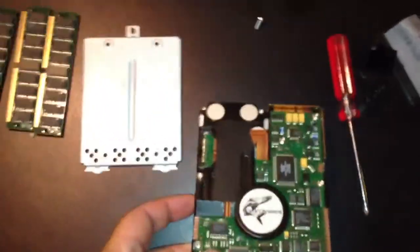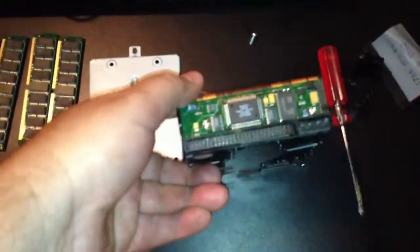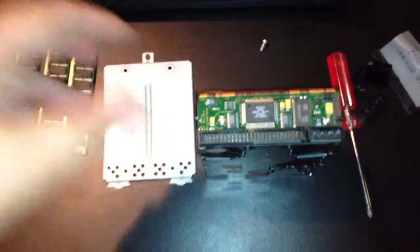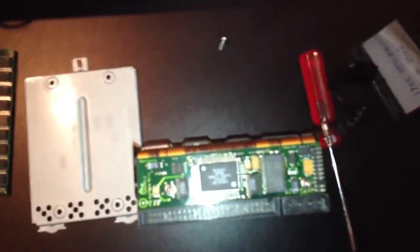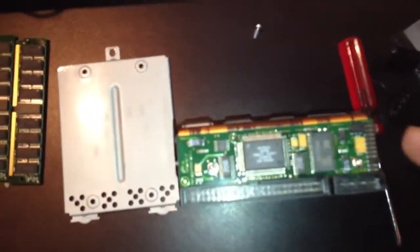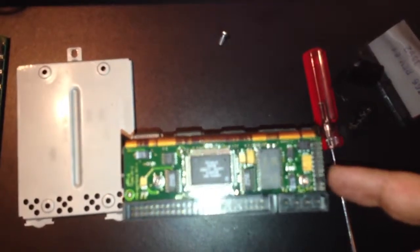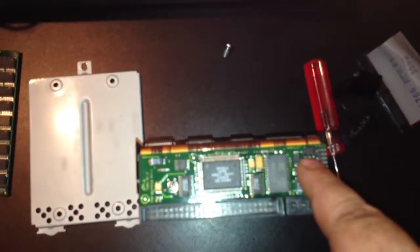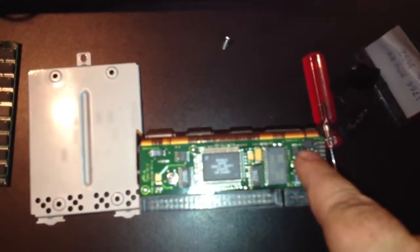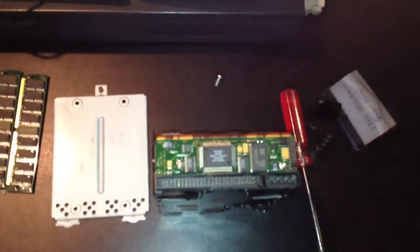And this is a Seagate ST15150N 4GB Barracuda that I've installed OpenStep 4.2 user developer and the Y2K patches on it, as well as set the jumper. The third set of pins up right down here is for SCSI ID 1, and then you need to set 3 jumpers here for termination enabled to the bus, as well as termination power. So you have those 3 jumpers in this one, and that'll get this drive to be recognized.